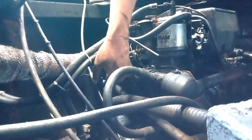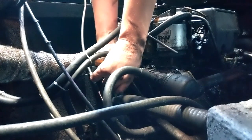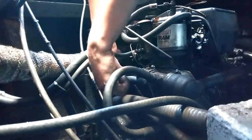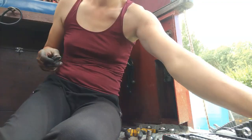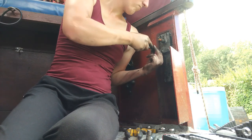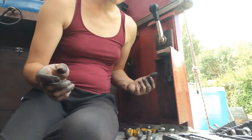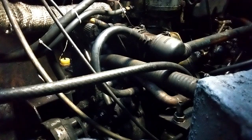At this point it's a good idea to make sure everything runs smoothly, as the ends of the cables may need further adjustment. I can finally screw the morse control back in place and then reattach the lever. And as you can see, everything seems to be working great.